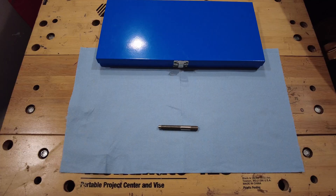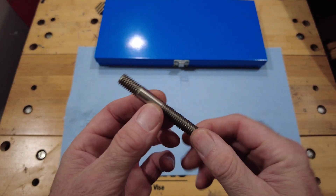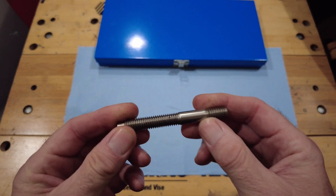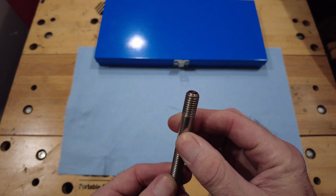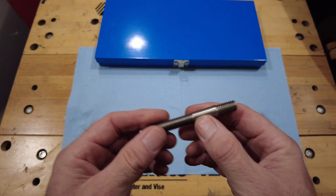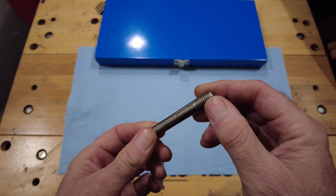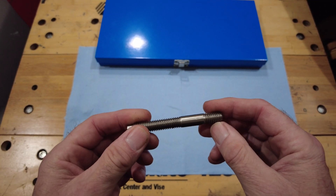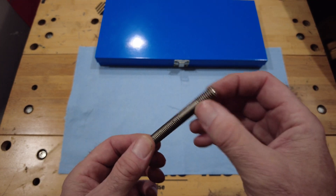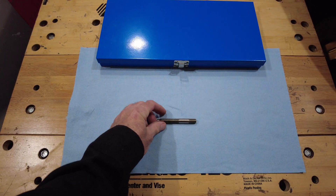Still got to work on that a bit more. I'm going to try something different — this is one of the new studs, a stainless steel stud that I'm going to put into that exhaust flange on the left exhaust manifold. One of the holes is stripped right now; it's a little bit small and there's no way this stud is going to thread into it. I almost thought I was going to have to go out and buy a new exhaust manifold, but I didn't want to risk taking the manifold off and having those bolts break inside the engine block.